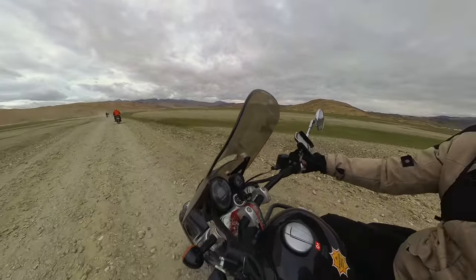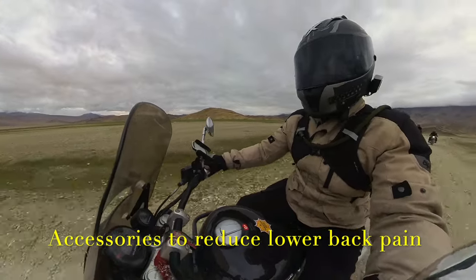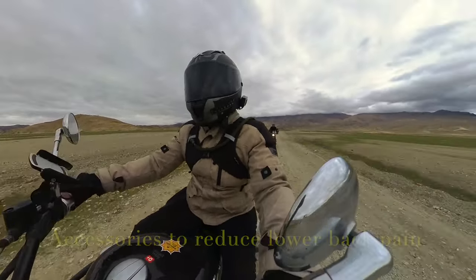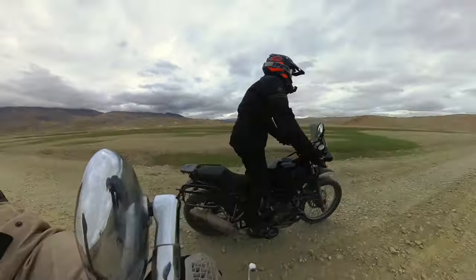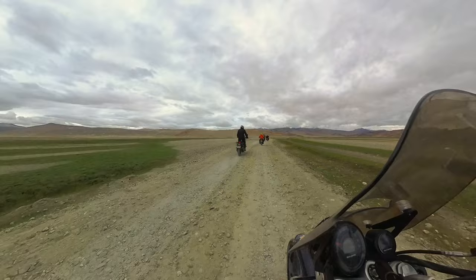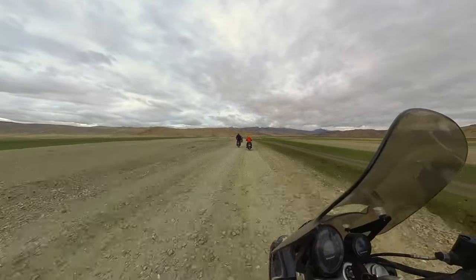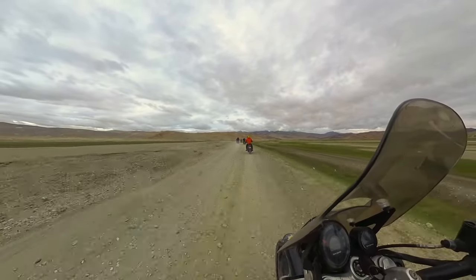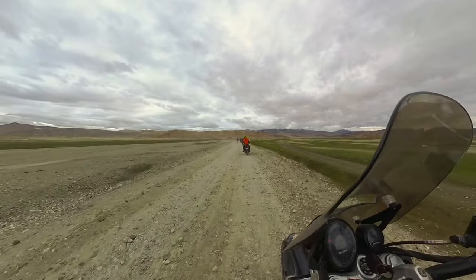I think this bike is perfect for riders of 5'10" to 6 feet. I don't want to change anything for that range. If your height is less than 5'10", then you can try putting a mini apes or a riser, which will bring your handle to a slightly backward position by 1 to 2 inches. So your riding angle will be very good and automatically back issues will be resolved, because the curved angle will become upright automatically.